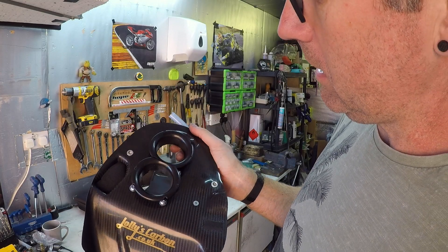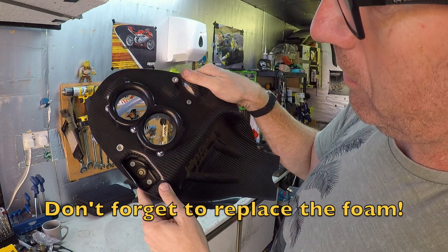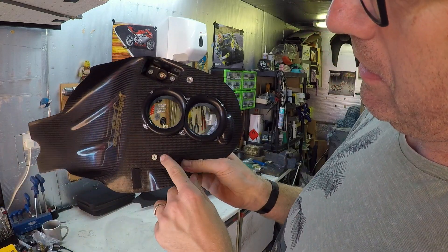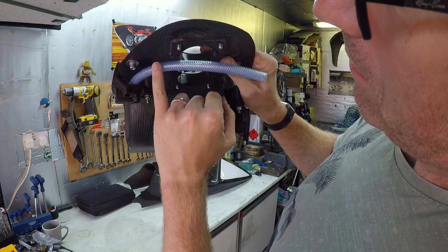If you're doing a gen 2 air tray, take the foam out of this side and fix the sensor in the holes provided with the bolts. Underneath, on this side there's one on the top there, and it goes round the breather pipe like that.